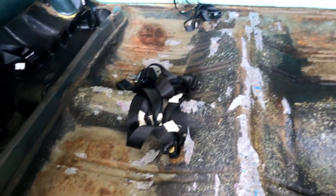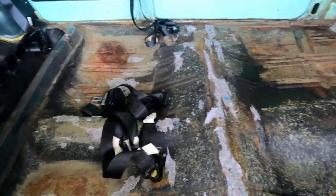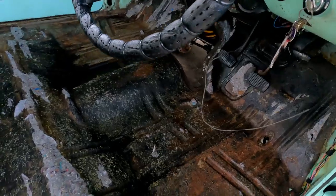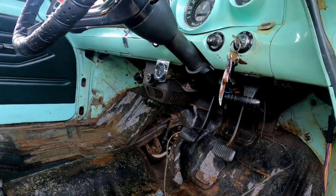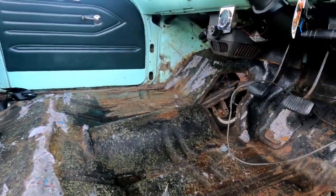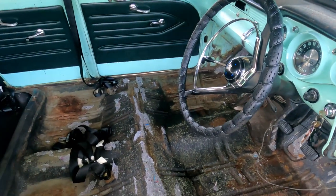Seats are out. I've left the seatbelts in. I'll loosely bolt the seats in there so we can see when we get it in, and check all the driveline angles — if the tunnel needs to be modified, it'll give seat clearance. I want to keep the bench and keep it registered as a six-seater. So I'll chuck the seats back in and just do them up finger tight, and pull the old heater out and the old Smith's temp gauge out — and that'll pretty much be it.